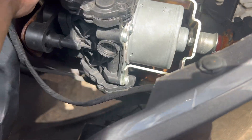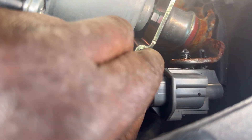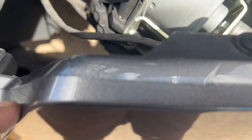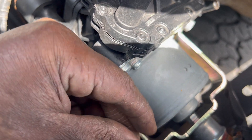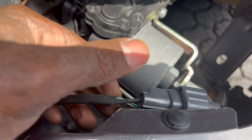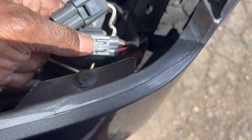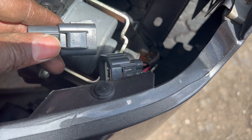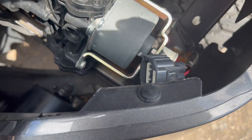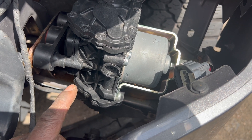You just push on this clip and pull — that's out. There's an electrical connection right here. I got it slid right out and I can get to it. This plug just pulls apart — you pry your fingernail in there and pull opposite ends and it comes out pretty easy. This pump doesn't look too old, it looks newer. I believe the previous guy said he replaced it.